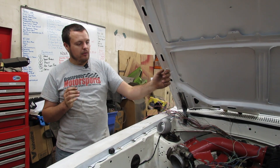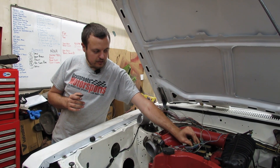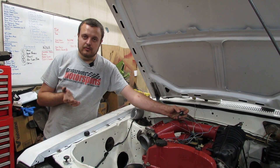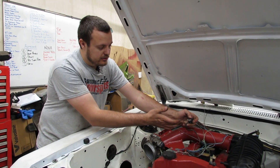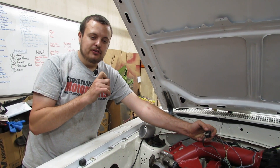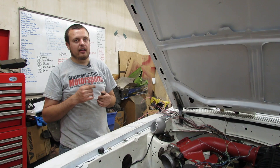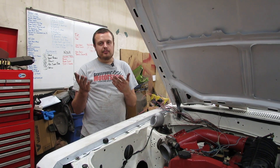Your outputs - let's take a coil for example. Some coils you have to supply with power, a ground, and some need a sensor ground. These coils are more simple - you literally just give them power, ground, and then there is a trigger wire which provides a 5 volt signal that tells the coil when to charge and discharge. Some ECUs require a pull-up resistor on that particular output depending on how the output is set up.